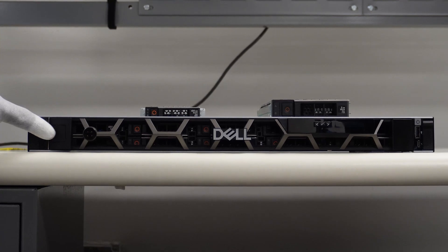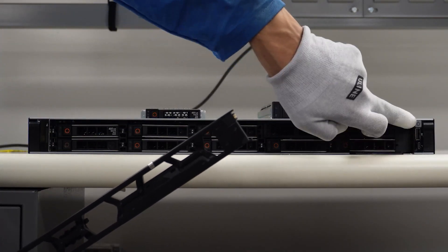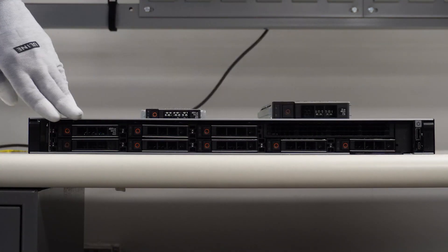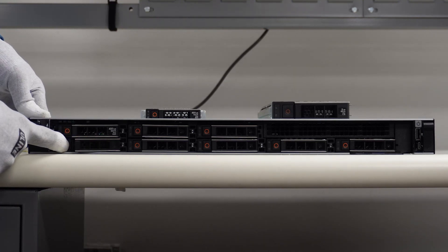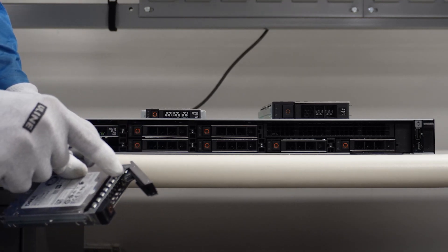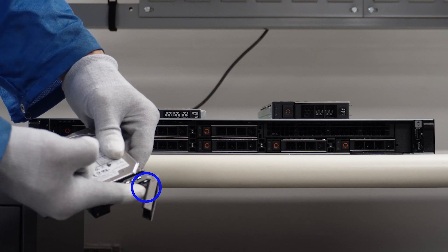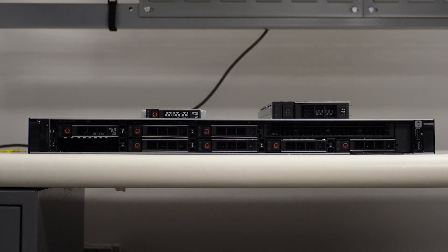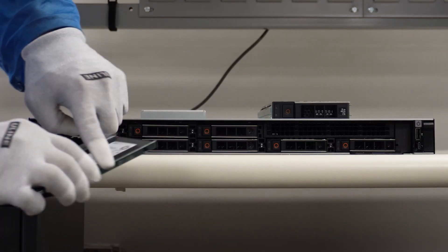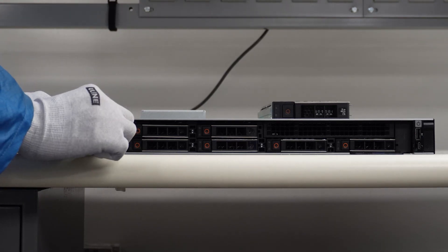First things first, we have this bezel on the front of our drives. Click this button and easily remove the bezel. To reattach it, it has hooks on one side — just put those in and snap it back on. To remove, just press that button and it comes off easily. Now, press the orange button, which pops out the lever so you can pull the drive out following the tracks. We just slide it out — this is the 2.5-inch hard drive. Sometimes it gets stuck; there's a spring in the middle. Just press on that spring and it'll simply come out. Now we're going to upgrade it with an SSD: pop open the lever, make sure the leads are following the tracks in the drive bay, then simply slide it in and push the lever down — it's safely in there.